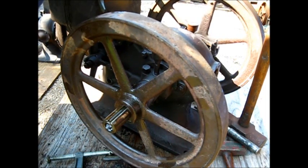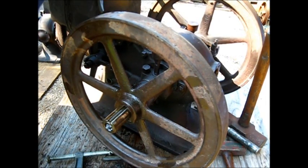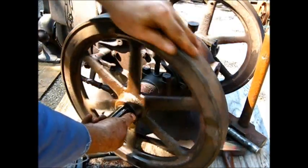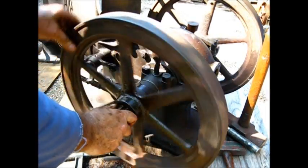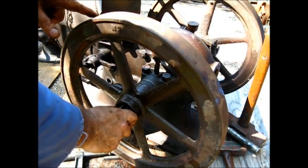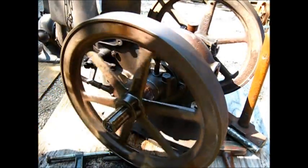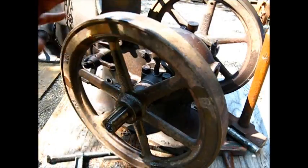What I did is prop whatever this is — don't let that move — and hold a little bit of pressure on the flywheel where it will bottom out on that spacer. Then you roll the flywheel around, observing the gap between the flywheel and the fixed point. If it deviates, moving in or out, then the flywheel has a slight warp in it.